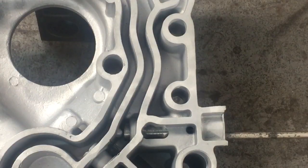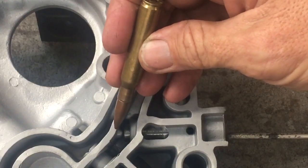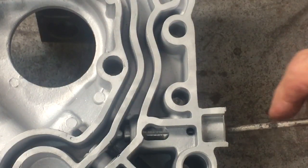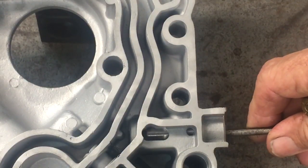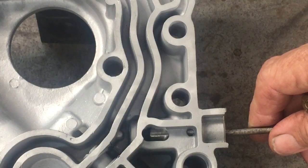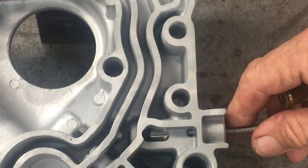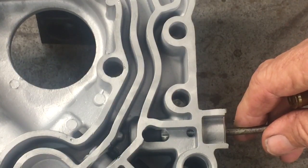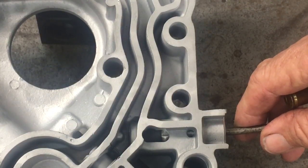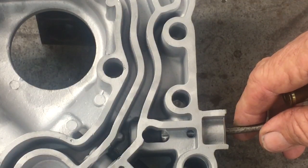The close-up shows the piston already in the bore right there — the piston against its stop, where it rests pushed by spring pressure. As the engine runs, the pressure will push the piston further back. There's the piston in its first position where it can relieve oil back to the unpressurized side of the motor. In normal operation it can stay cracked open like this. When the oil is thick, cold, and viscous, you'll need more area to allow oil flow so that the pressure doesn't build up excessively high. This is an effect of having a high-volume oil pump and only occurs when the engine is cold — that's why the enlarged opening is important.